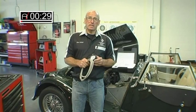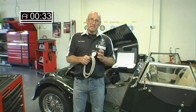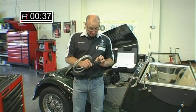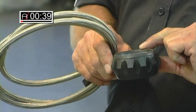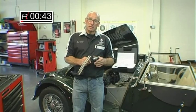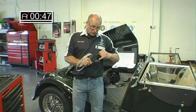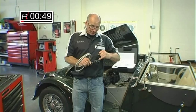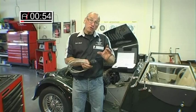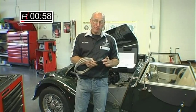There has been in existence for some time a simple tool — it's a pressure gauge for testing excessive pressure in the exhaust stream. This particular gauge goes minus one bar, around 30 inches of mercury, to plus two bar of pressure. In a normal environment, we do not anticipate more than somewhere around five inches of mercury, which is about 0.2 to 0.3 of a bar total maximum pressure in the exhaust stream.